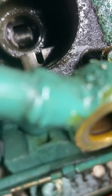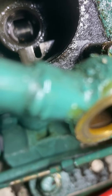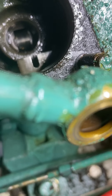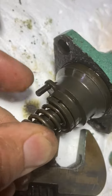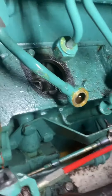So there's a little thing with a hole cut in it that's moving a little bit right now. Your throttle moves that thing back and forth, and it wasn't moving. Inside that little hole, the nipple on your fuel injector — this thing right here — it goes into a hole and goes back and forth and opens and closes. It was not engaged in there; when I moved the throttle, it wasn't moving that at all.